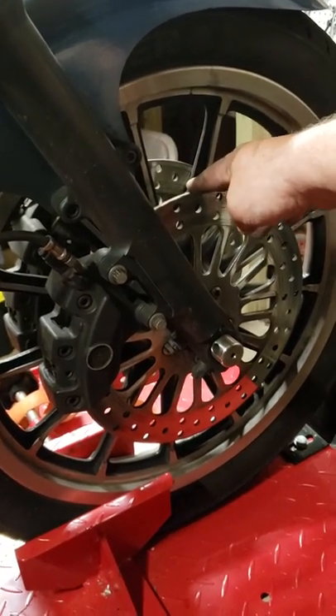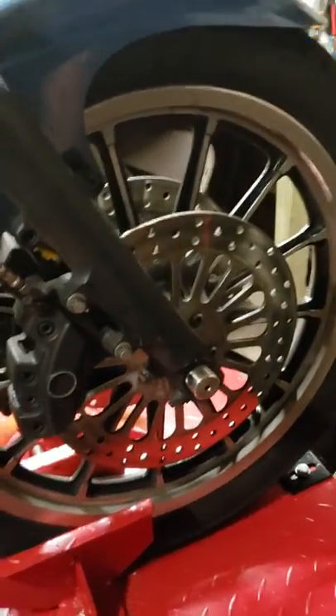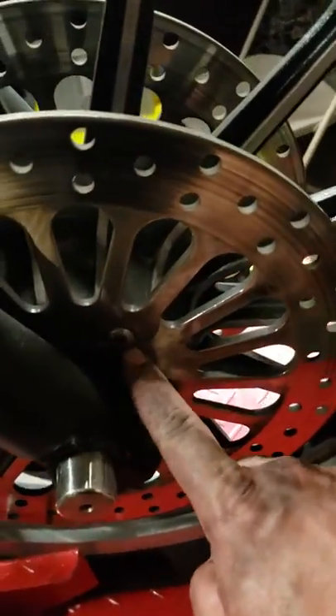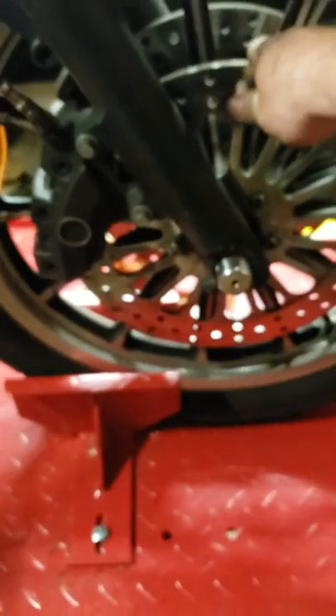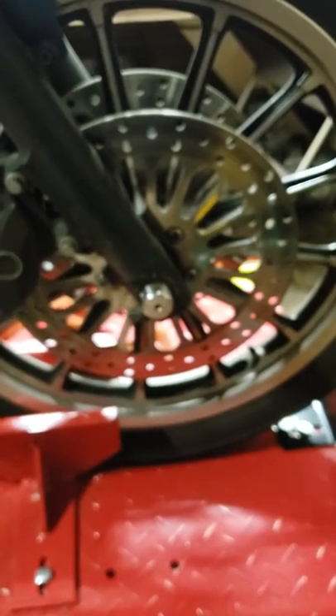And of course larger rotors are not a bad thing, but you cannot use just FLH rotors because the bolt holes here are not counterbored for head clearance. You will not have the proper amount of clearance in between the head of the bolt and the fork lower. These calipers are set to fit an 08 Dyna — it's supposed to be just a single disc, but they ran an 11.8 inch rotor on that side.